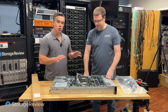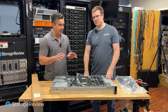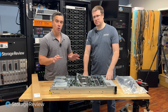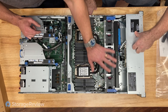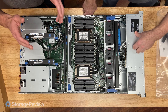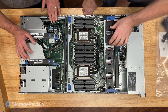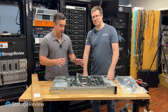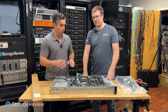There's a little nuance worth talking about — this system can be sold with just two CPUs, and in most of those configs the CPU layouts are air cooled. Looking at the manual, there's a different fan kit that goes in for that config — still five fans but a dual rotor setup. When you get to the quad CPU systems, that's when they go to liquid cooling, if you're over 270W TDP per processor. They go up to about 350W, and once you start pushing that much thermal energy, you need a better way to capture and move it.